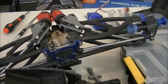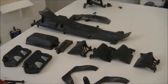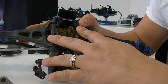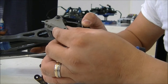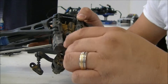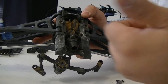I'll teach you guys a little tip on taking out the chassis. The diffs are all nasty — I race, I know — but this is what I do every time I come back from a race: take it apart, clean it, ready for the next. When you remove this chassis, the rockers that go on top — you want to remove the rockers. I had a problem where the chassis didn't want to come out with the rocker there. So remove the rockers, that way you can slip the chassis right out. Just lift it up and slide — slides out perfect.